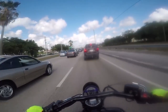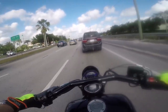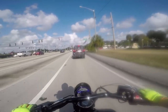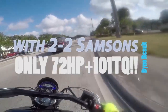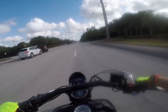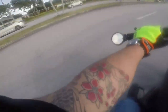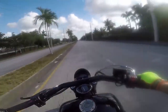I can give you an example. When I got my bike it was completely stock and I put a two-in-two exhaust — I bought a Samson Slasher exhaust. I knew you have to dyno your bike after that and re-jet it because the fuel and air mixture is changed. So I did exactly that, and that was without a big air kit. When I put it on the dyno, my numbers actually stayed the same. I did not gain any performance — rear wheel horsepower was like 72 and torque was like 101.